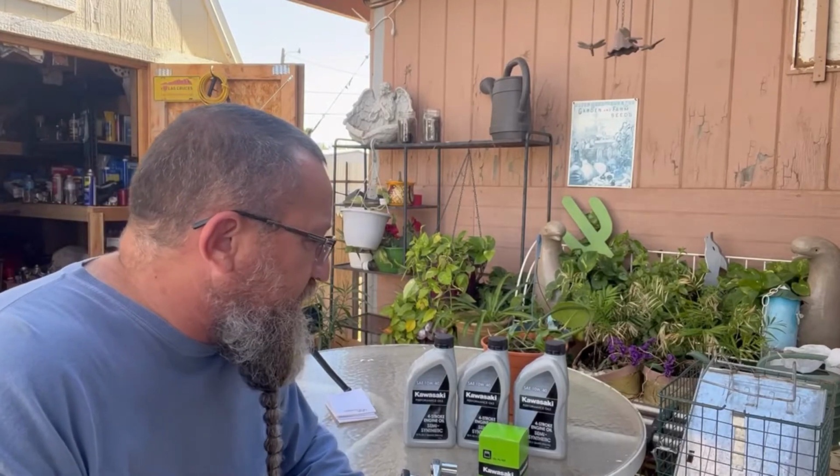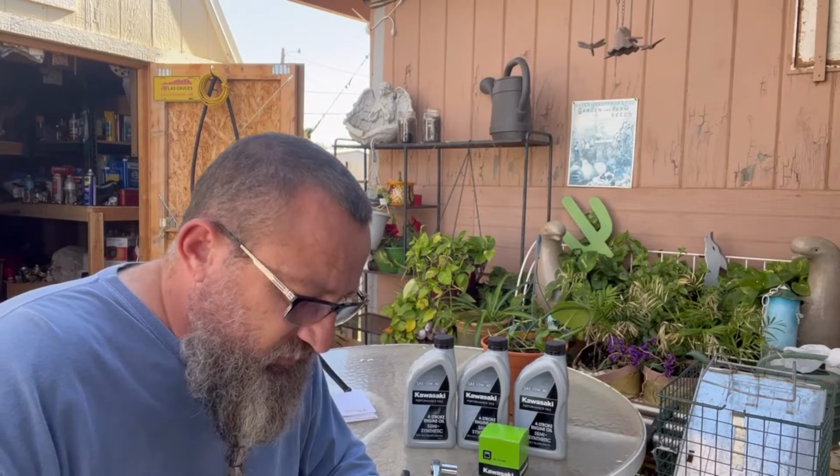I'm just going to use the little wrenches, because the torque wrenches I had just drove off in the back of the car with my daughter. I'll tell you, one thing after another. The oil filter cap is 78 inch-pounds. You can check your owner's manual. If you divide that by 12, you get 6.5 foot-pounds. The torque wrench wouldn't go that low, so I did find an inch-pound torque wrench to do 78 with.